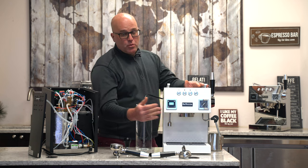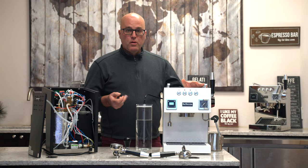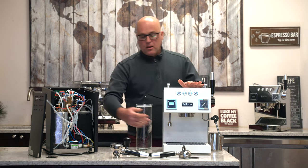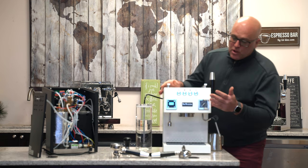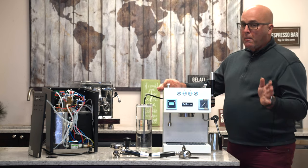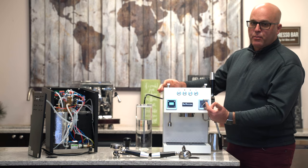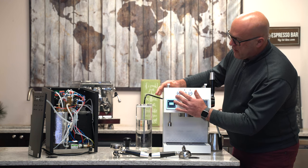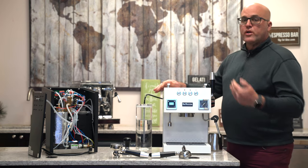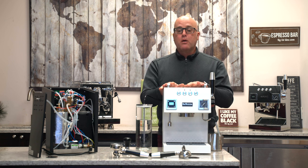In another video, we're going to go over the menu, where you can program the pre-infusion, program the temperature of the coffee boiler and the steam boiler, use eco mode — there are different settings for eco mode — and also program the amount of water that comes out through the water spigot. Quickly over the buttons up here: they are nicely lit with white. You have your brew pressure gauge — not a pump pressure gauge, but a brew pressure gauge, which means a finer grind will increase the pressure and a coarser grind will decrease it. You have your hot water button, single cup dose button, and double cup button, so you can program the amount of water through the coffee grinds with those two buttons. And then your manual on-and-off for the coffee. So you actually have three buttons there, which is a really nice feature.